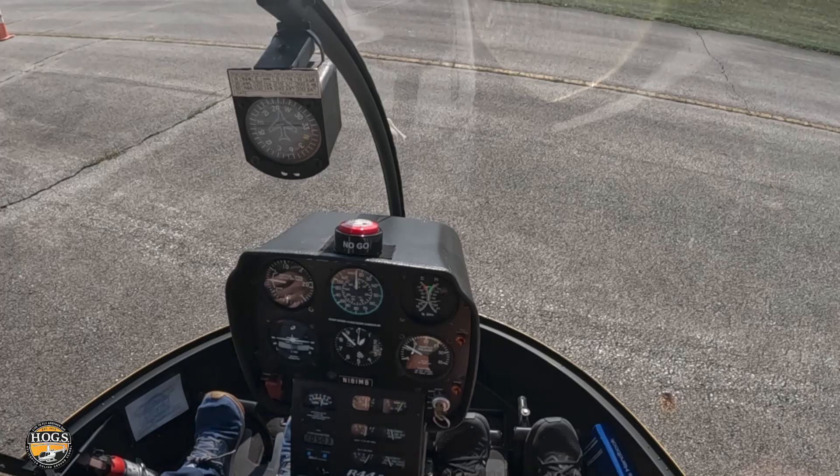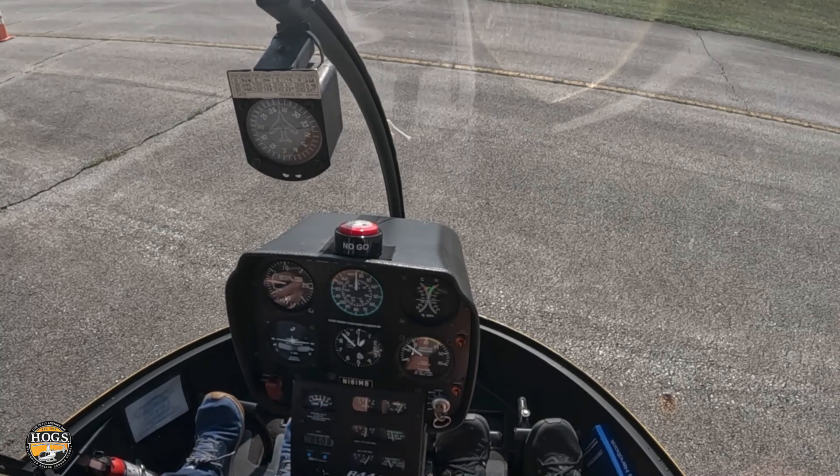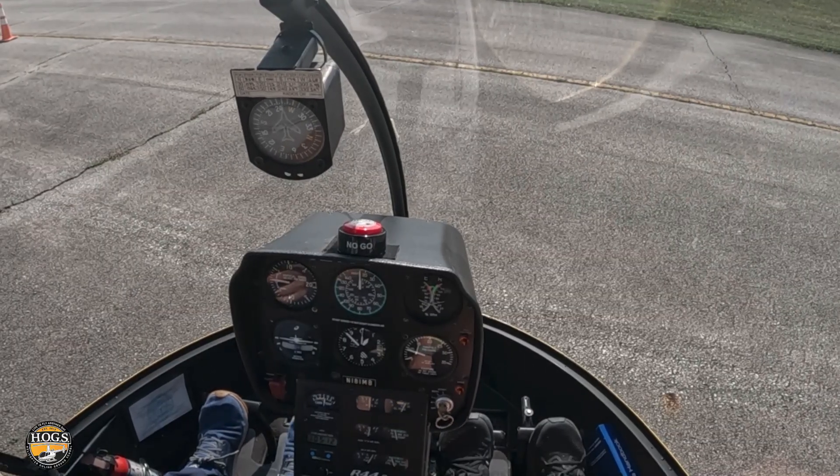So our assist can do its job. Going to go up to 75%, then we're going to close the throttle, and we see a split on the needles. Let it come down to idle.